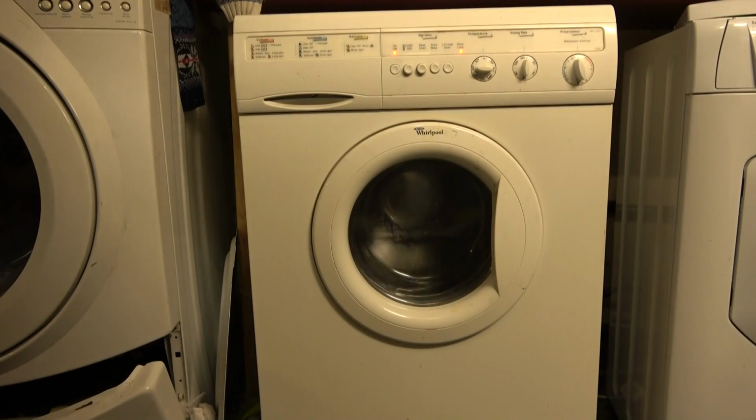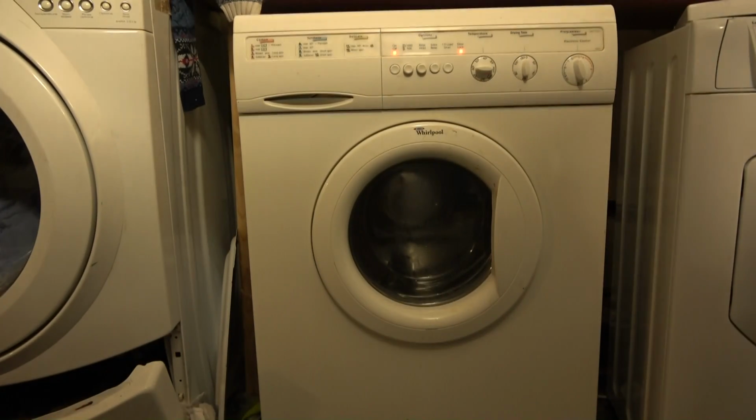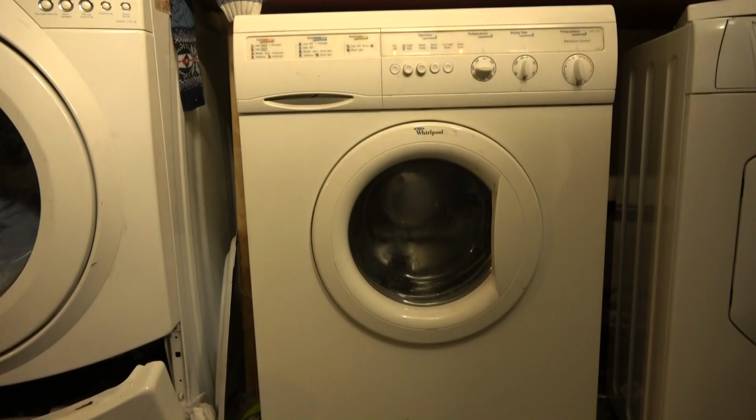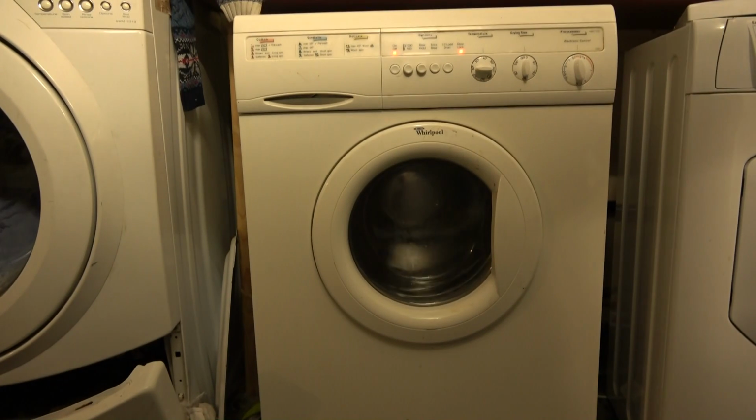Alright, so let's just test this out. This is actually quite an important machine for me. My Nana had this before her Candy CN146, that is obviously on the channel. But this is basically the childhood machine to that. Underneath it's a service. I think it uses the older style timer, pretty sure, just going by how long it is from here to there. The newer style timer is like on the KRS, for example. But of course, this uses an induction motor rather than a brush motor, because all the washer dryers did.